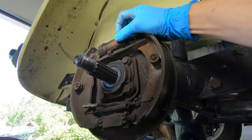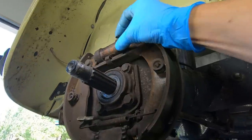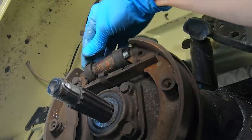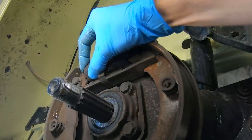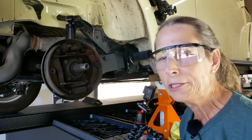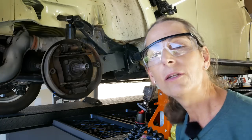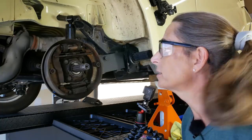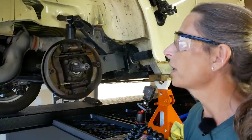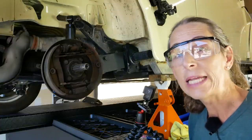Let's see if we've got any leakage underneath here. On one side it looks nice and dry — but on this side, uh-oh, look at this. I've got a bunch of fluid here. That's not good. Looks like this cylinder is just not in good shape — just like the front one wasn't either. So we're going to have to either repair it or replace it.